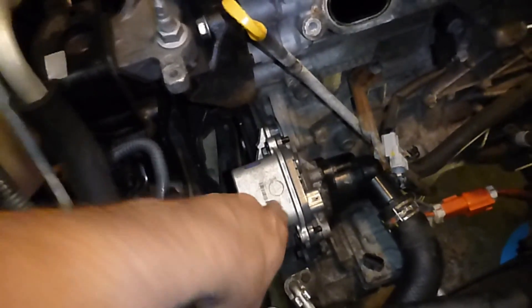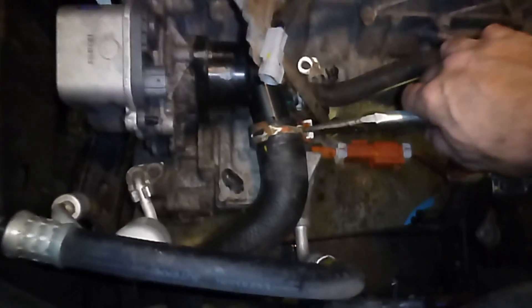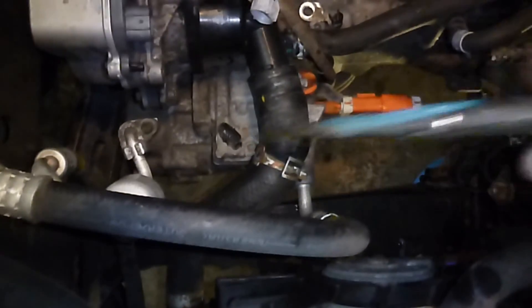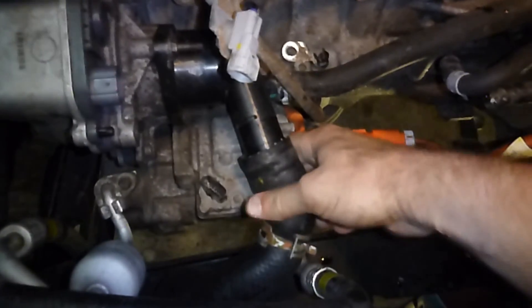The old new water pump comes out because there's not enough space here. You see that? The frame rail versus the water pump — the frame rail is going to win there. So we take out the water pump. While we're at it, we're going to remove the hose for the radiator hose to the thermostat. It should be fairly easy to get off.